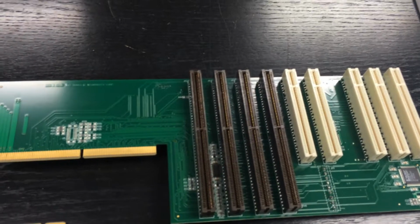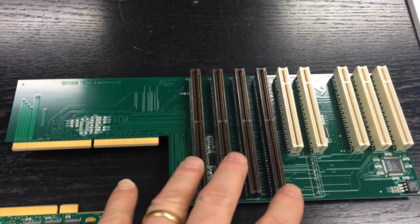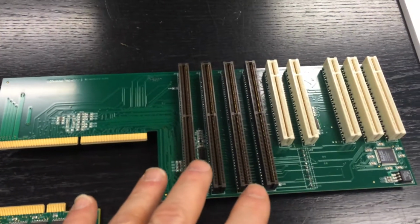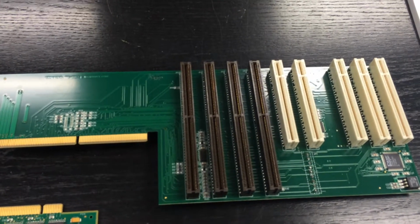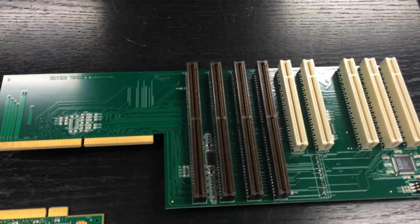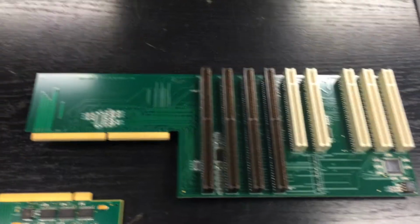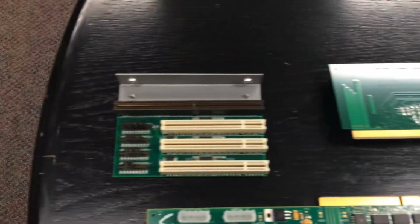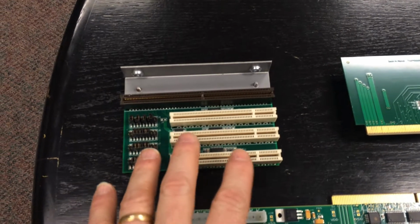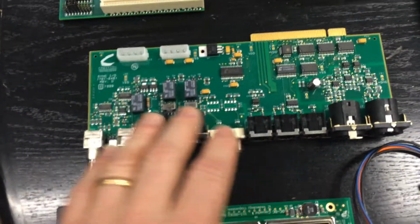Very critical part. All of the digital I/O lines on the SIC0 are very carefully designed for low jitter, including balanced clock lines using microstrip technology. Everything is impedance matched all the way through, so there's no reflected waves and no jitter induction at all inside the Radar Studio frame. Then we've got our SIC0, which you'll see where that goes in a couple of minutes when we install it. And this connects all your digital I/O boards and your Sync.io board.